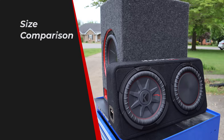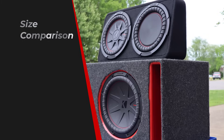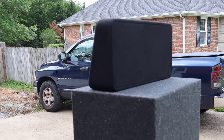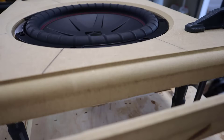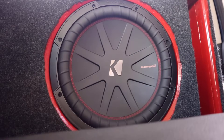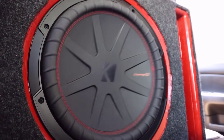To get an idea of just how compact this enclosure is, here are some side-by-side shots with an enclosure I built last summer. That's a 2.5 cubic foot net enclosure — 2.5 cubic feet of internal airspace after accounting for bracing, port, and subwoofer displacement. It's tuned to 34 hertz with a big port wrapping around the inside. The driver is a Kicker Comp R12, while the drivers in these compact enclosures are the thin versions — the Comp RT. These enclosures were built for entirely different purposes. The larger box is oversized for more output and tuned lower to play lower — it's a no-compromises, get loud, get low subwoofer box.